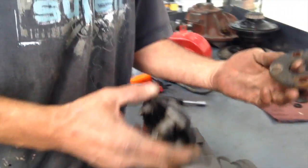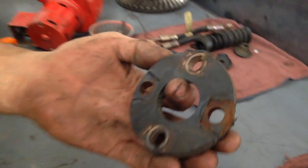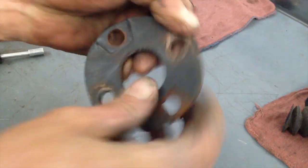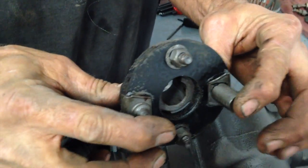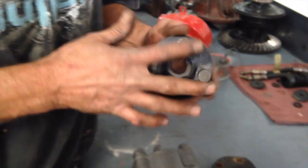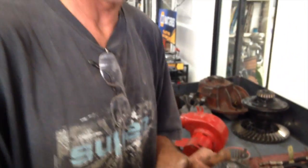This is how the steering couplers come. For some reason, I believe it's '71 to '73 — are very difficult to get couplers for. They come with just the piece of rubber. The only problem with that is these dowels right here are safety locks, in case something happens to the rubber. On the steering shaft there's a fork, and if anything happened to this rubber — it melted, got destroyed — it would be sloppy, but you would still be able to steer the vehicle.